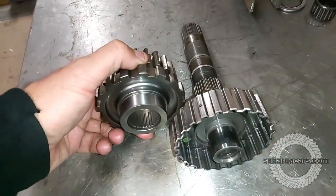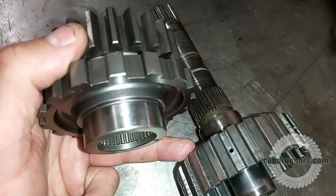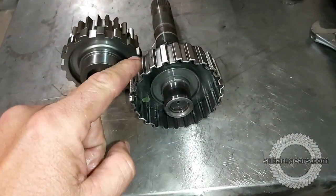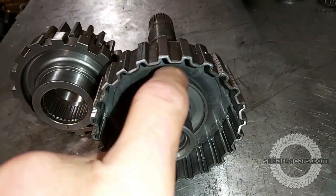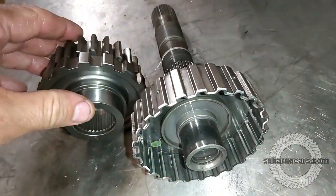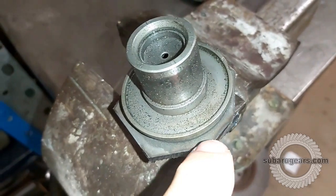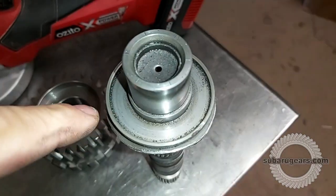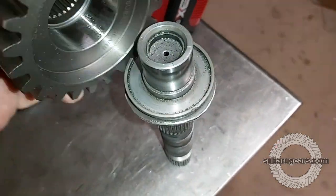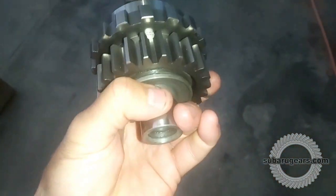The next step is to assemble this sprocket onto the shaft, but the all-wheel drive clutch pack is in the way. We're going to have to remove this AWD clutch pack but keep the remaining area where the thrust bearing goes. We've cut the clutch basket off roughly with the large grinder, and now we'll use the small grinder to round it off near the edges so our sprocket can fit on. Now it's cut down small enough — it would be nicer to do on a lathe but you can do it at home. We'll put this on backwards to make sure there's clearance all the way around.